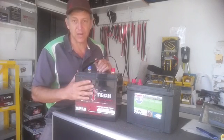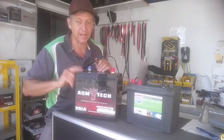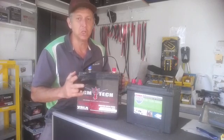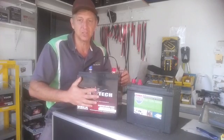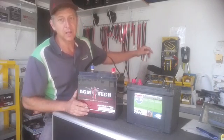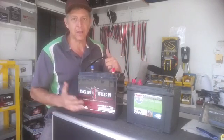This one we sell here at the shop for $160. It has 180 amp-hours and it's 6-volt. When you take a 6-volt battery you'll need to buy two, and you put them together in series. It's real simple — you take a cable that we have on the wall over here, connect the two batteries together, and now you have 12 volts.